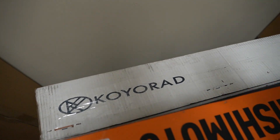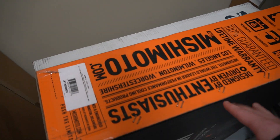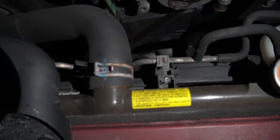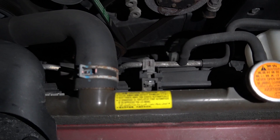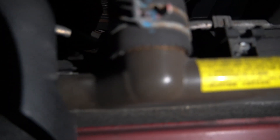One of the first things I got is a big Koyo radiator and Mishimoto fans. The fans aren't really 100% necessary for upgrading coolant-related stuff, but the radiator is one of the things I recommend replacing first on a Subaru because of the issues they have with the stock radiator. Our cooling systems are kind of prone to failure.